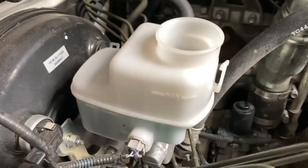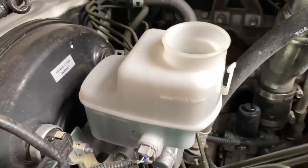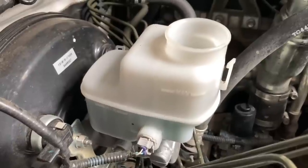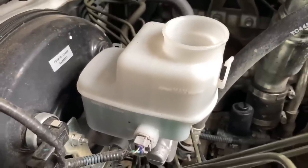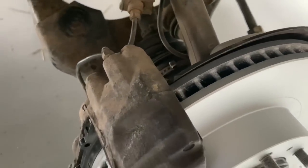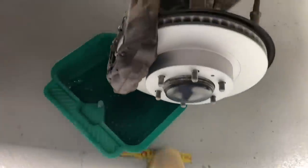Okay, I'm going to drain this out. That's about as much as we could get out without too much trouble. It's down to the minimum. Now, I'm going to do the front brakes for today because we did the front pads and rotors — keep it a simple DIY solution. All you need to do: normally you've got a rubber boot on the back of that caliper there, but in this case we don't have one. Just grab a 10mm spanner. Open it up a little bit like that and you'll see the fluid starts dripping out immediately. We've just got a drain tray underneath to catch it. Keep it simple.